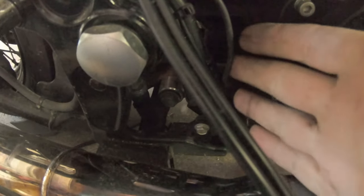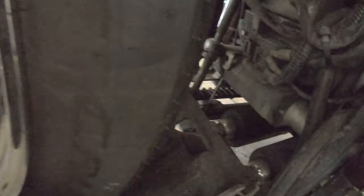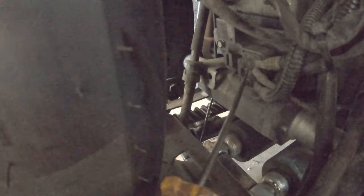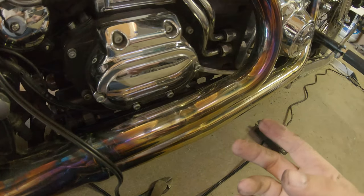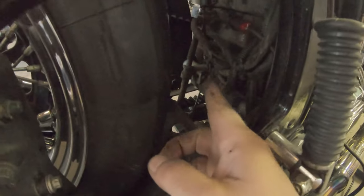We tracked the wire — it comes back and pokes up here by the transmission side cover, and up through the back. Right there is the main fuse block with a 3/8" nut on it. I'll pull the nut, free up the wire, get it out of the bike, and run the new one. Didn't come across any zip ties — either this isn't original or they did things very differently 24 years ago. I'm going to throw a couple zip ties in there; they're cheap insurance.